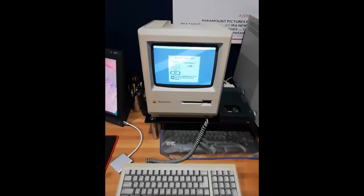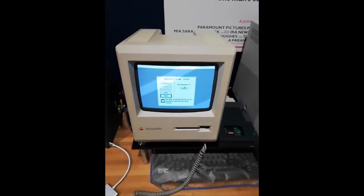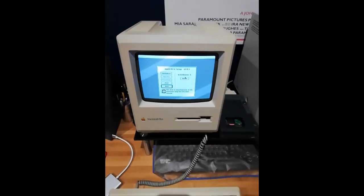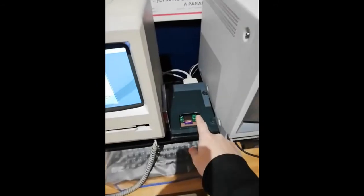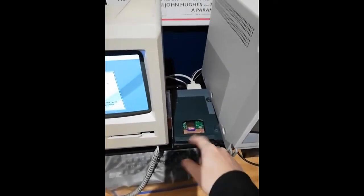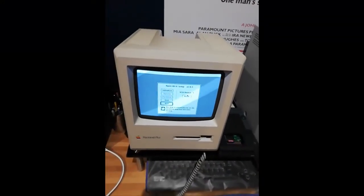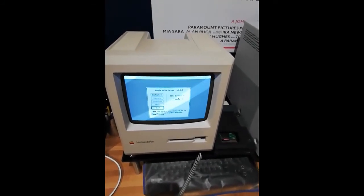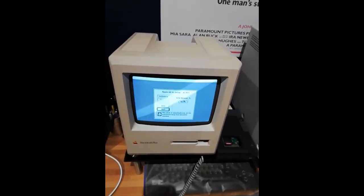That was it — that's what I wanted to show you. I've seen on the net that a lot of people are having trouble getting the SCSI2SD to be bootable on a Mac Plus, and this is just to show you that it is achievable and it actually works. Even the mod for providing termination power so you don't need an external power supply is very doable and easy to achieve. It's well documented on my website — just go to retroguy.blog and check it out. Hope you enjoyed it; if you did, hit the like button. See you later!